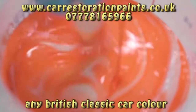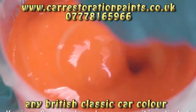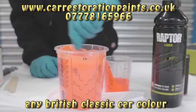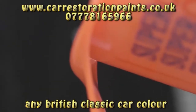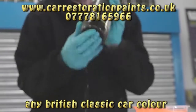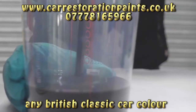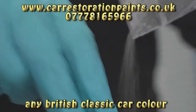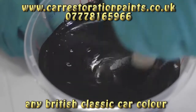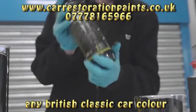Measure the desired ratio of color — up to a recommended 10% of solvent-based toner, solvent basecoat, or 2K solvent paint. If using a two-pack color, please ensure it is activated prior to addition to avoid undercure. Note: Raptor is not recommended with waterborne paint systems, and only 5% color can be added directly to the Raptor bottle — anything above must be used in a measuring cup to avoid overspill. For a slip-resistant finish as defined by British Standard 7976-2, Raptor Traction can be added — recommended 200 grams per liter. This is recommended to be applied as the final coat.